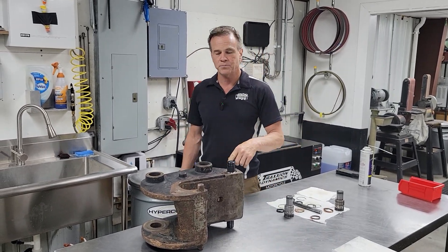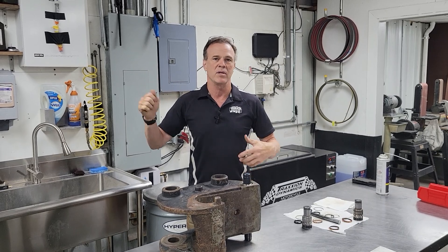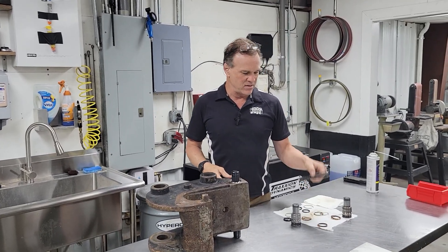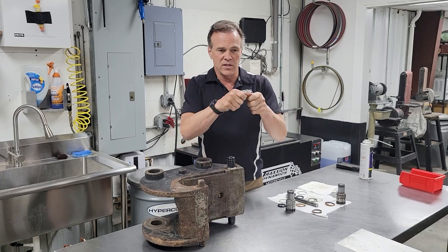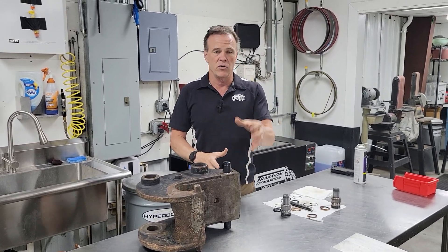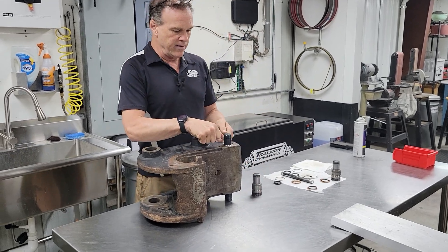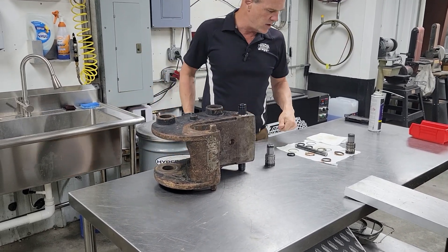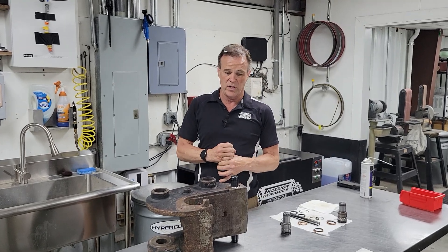I did use the press to reassemble mine — same thing with a socket. You don't need a powerful press, just enough to compress that spring, which you're not going to be strong enough to do by yourself. So I pushed it way down in. There's enough drag and tension that it's stronger than the helper spring. When I relaxed the press, I left it in position but slid my clip in and down so in case it popped up it wouldn't hurt me. I got my clip down in and it never tried to pop up. I ended up using a screwdriver through the hole in the end, put a block under it, and pried and wiggled it to get it to come back up to its fully extended location. The seals really have a lot of grip on it.